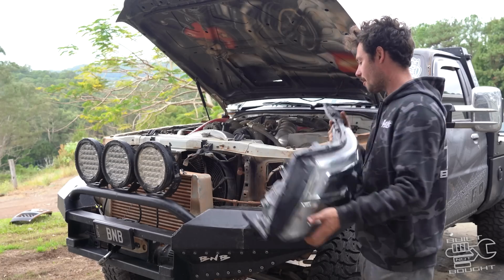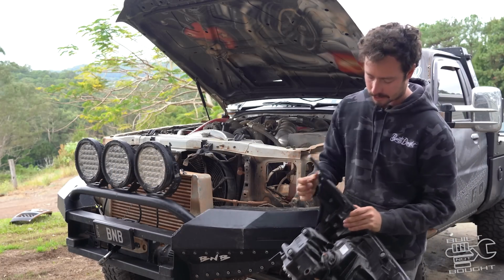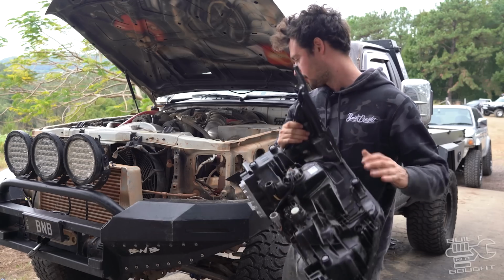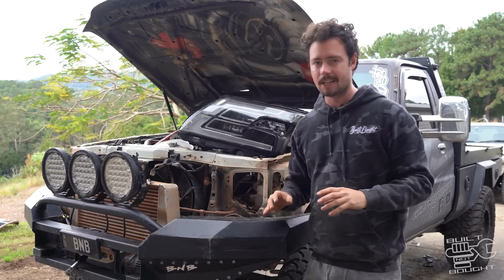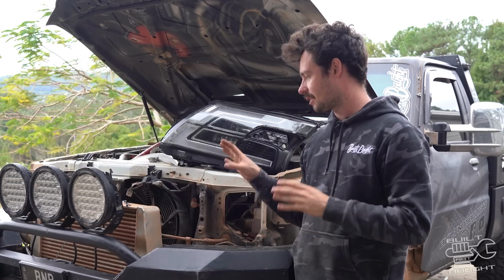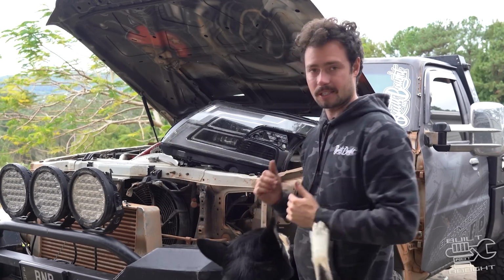Okay, this thing is freaking gigantic. I think it's going to be a combination of cutting the body and cutting some of this headlight. Like, we don't need all this plastic on the corner here. Trim this down as small as we can. But I think similar to the 200 when we did the front end on the 80, we'll start from the middle and work out. So let's get the grille mounted and get that centralized, and then we know exactly where these lights need to start.